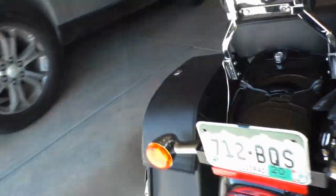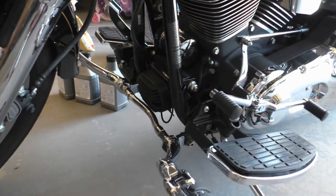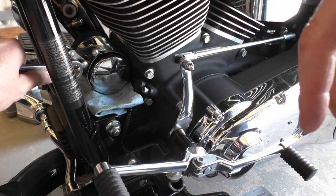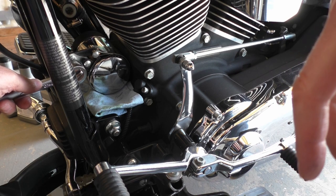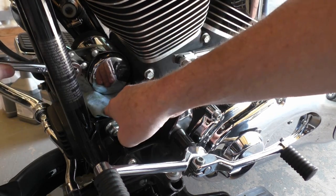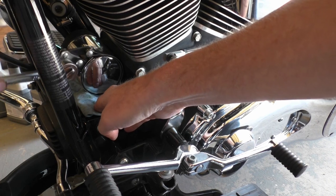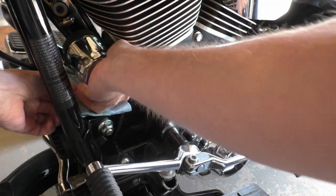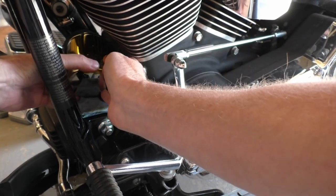Now we're going to come around to this side and I'm going to take off that oil filter. I loosened it a little bit — you can use whatever oil filter wrench you like. This is where it gets a little messy, and it's actually an advantage to have the bike tilted at this point. I put a rag down under here and my oil pan in the bottom so that if it drips, I won't make a big mess. Get it to where I can hand-loosen it — and then the key is speed. There we go.